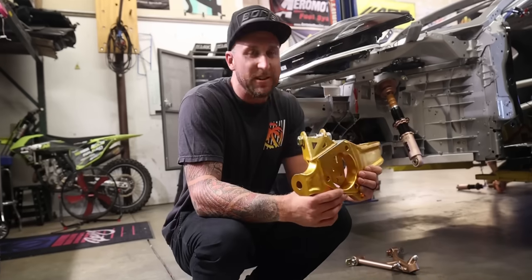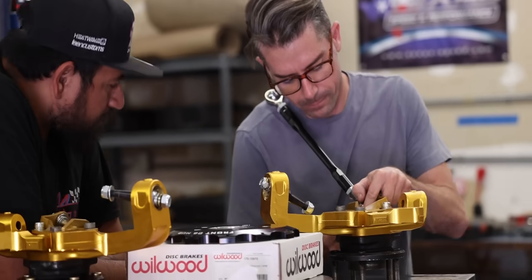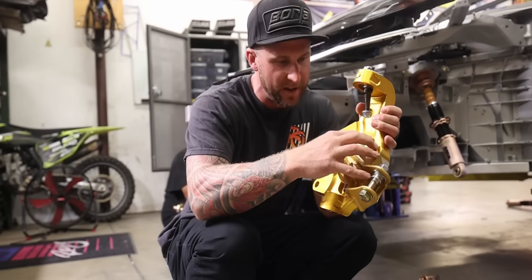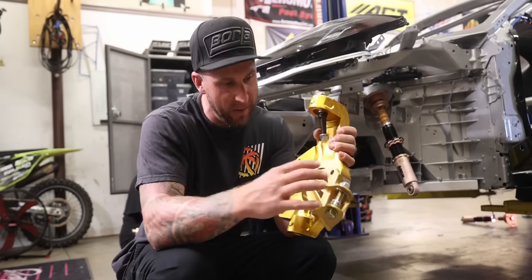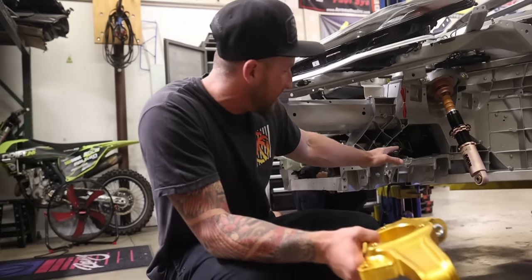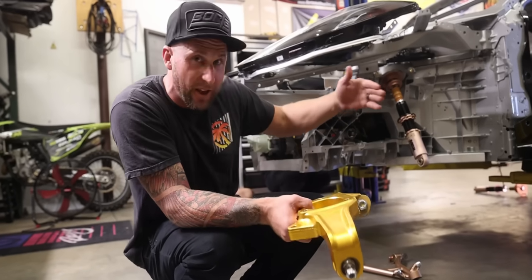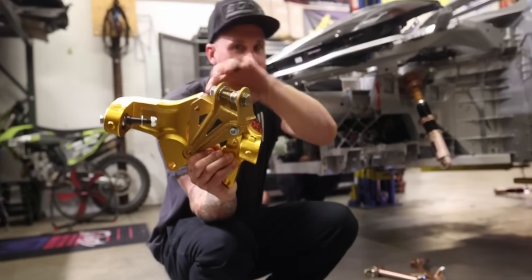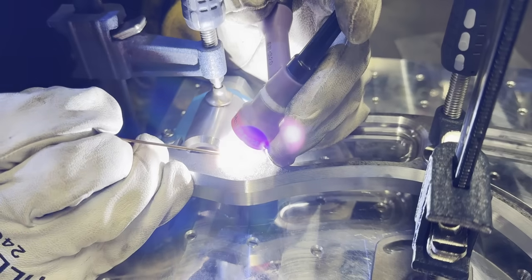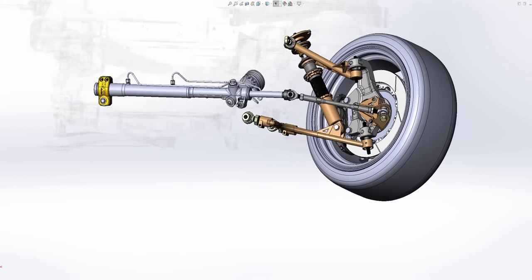Because stuff is different — a lot to digest here. This is the C6 steering knuckle that we use on the demo car, the race car, but it's been modified. We've chopped off the tie rod pickup point, and Chris has designed a bolt-on piece that bolts to the three bolts of the hub and puts the tie rod pickup point in the desired location. Although we're using a C6 steering rack, everything's in its own happy place — it's slightly further towards the centerline of the hub versus a C6. This lower control arm also needs to be designed for the right amount of angle, and Chris has this thing measuring out at like 65 degrees of steering angle or more than we're going to need.